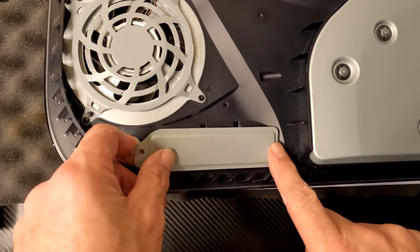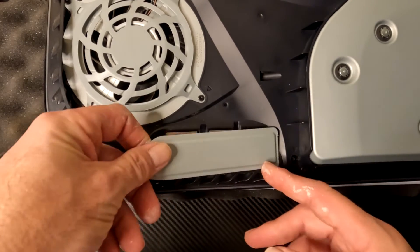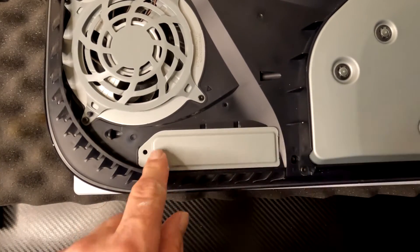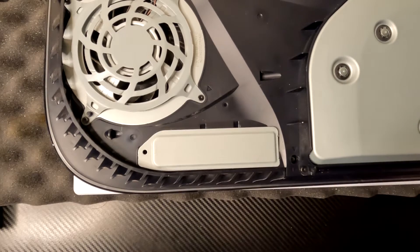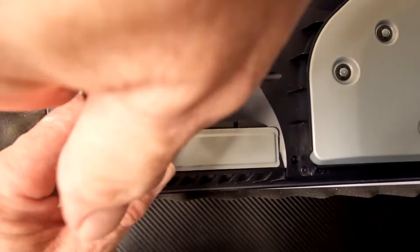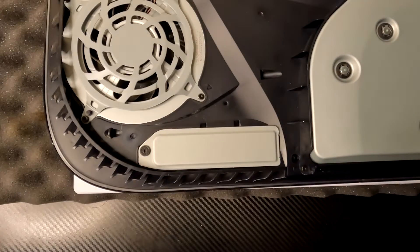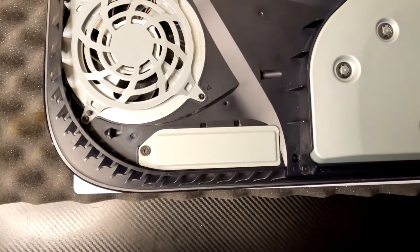Take the cover — it's got a little lip on the edge here. Slide this little lip under like so. Put the screw back in that we said not to lose in the first place. If you look at the cover, you'll see it's got angled little pins that drop down into these little angled holes. Remember we flipped it around, so it's going to go back on the opposite way we took it off. It's going to slide into place — click — and you're done.